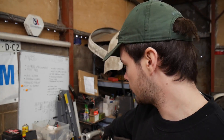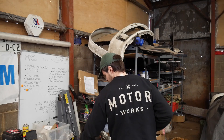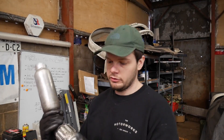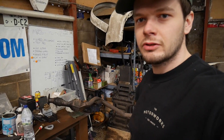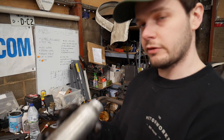I figured the next logical step would be to cut the flanges off. Just double check it's the right flange you've cut off as well. Unfortunately it is. Right, well that's metal. We'll have to do some clean-up. We're basically pretending to be a metal fabricator today. So that's the flange that goes on the turbo - that's the bit we're going to be trying to weld to. I might clean it up a little bit. It doesn't really look like it's going to be long enough.